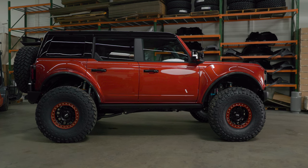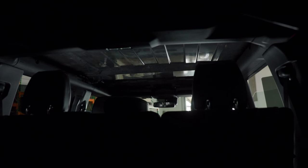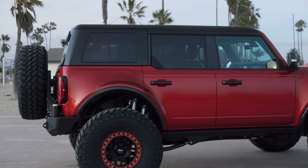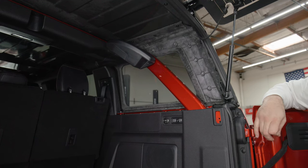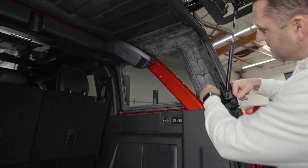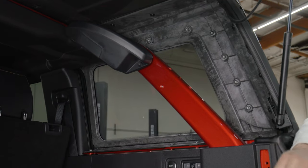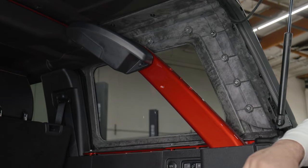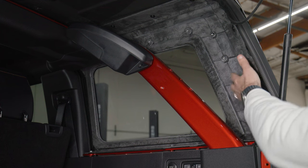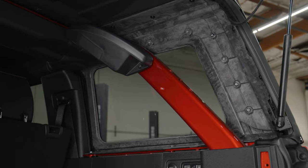Something really awesome about our one-piece and modular hardtop design is — again, the theme is the vehicle is modular. The accessories you put on should not remove that modular and accessory capability, and in some cases should expand upon it more than factory. On our rear side panels we embedded a whole series of 6-millimeter inserts with almost 100-foot-pounds of pull-out capacity and fantastic torque strength — so you can mount shovels, fire extinguishers, radios, flashlights, or our optional MOLLE panel that goes across.